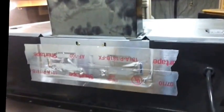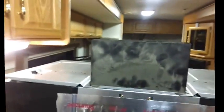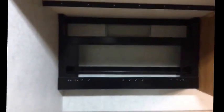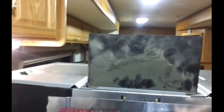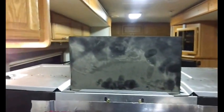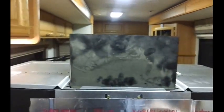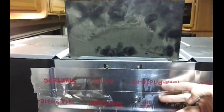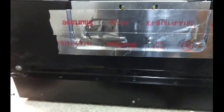It's another day and I'm fixing to put this back together. My microwave was blowing the air out front instead of blowing it out the side of the RV. There's my vent right there — that's where it was supposed to be blowing the air out. But from the factory, they installed the little squirrel cage blower in backward, so it was shooting it out the front. I took it out, rotated it, put it in the right way. Then it left me some holes, so I had to tape those up so it wouldn't be sucking air from the top of the microwave — it would be sucking it from the front where it's supposed to, and out the ductwork.